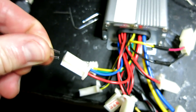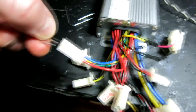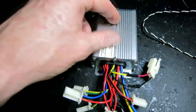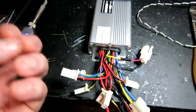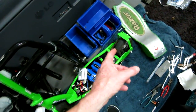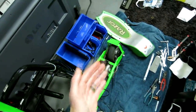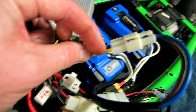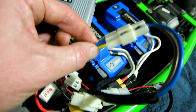Put the paper clip inside the pins so it loops around — one pin in one hole, the other pin in the other hole. You'll hear a click — that's the relay inside the controller, and that will keep the power on to the unit the entire time. After hooking up the motor to the controller, if you are getting a reverse spin — meaning when you hit the throttle it's moving in reverse — you need to take the blue wire on top and the yellow wire on the bottom and reverse them. That will give you the forward motion.